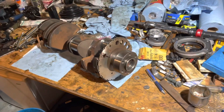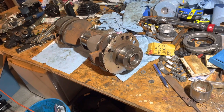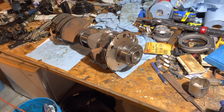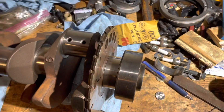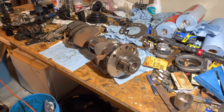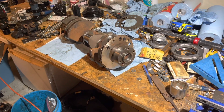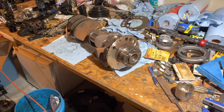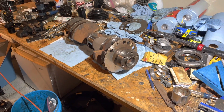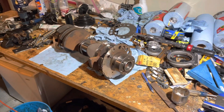So that's the inexpensive way of swapping a 24-tooth for a 58-tooth wheel on the LS crankshaft. The reason I'm doing this is I have an LC9, which is a 2009 5.3-liter engine. I'm going to be replacing the 5.3 with a 6.0-liter engine from around 2000-2001. The LC9 has a 58-tooth trigger wheel, so I can't run the 6-liter with a 24-tooth wheel in a 2009 vehicle, so I'm going to swap trigger wheels.